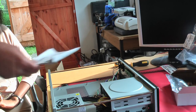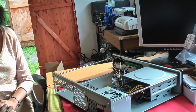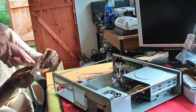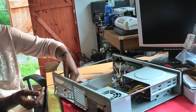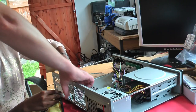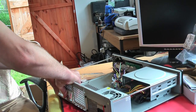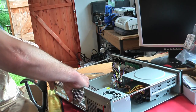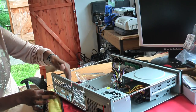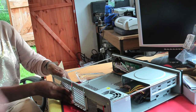The first thing we'll do is install the back plate. The writing faces the right way — it goes in from this side. Be careful because it's very jaggy metal on these cheap cases, don't cut yourself. You sort of push it in at the top and it clips in. It's cheap and bendy so be a little bit careful, but it is now in there. All we've got to do now is fit the motherboard and connect all these connectors to it.